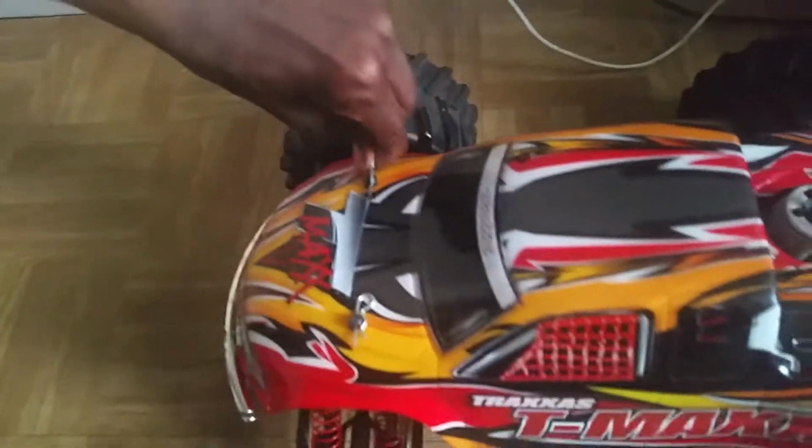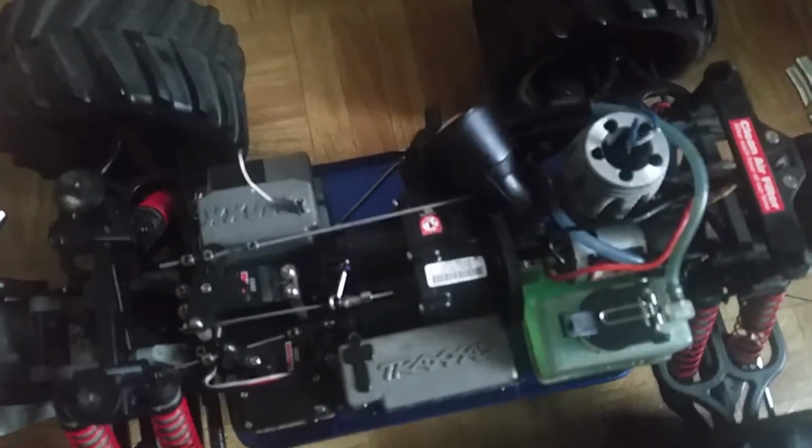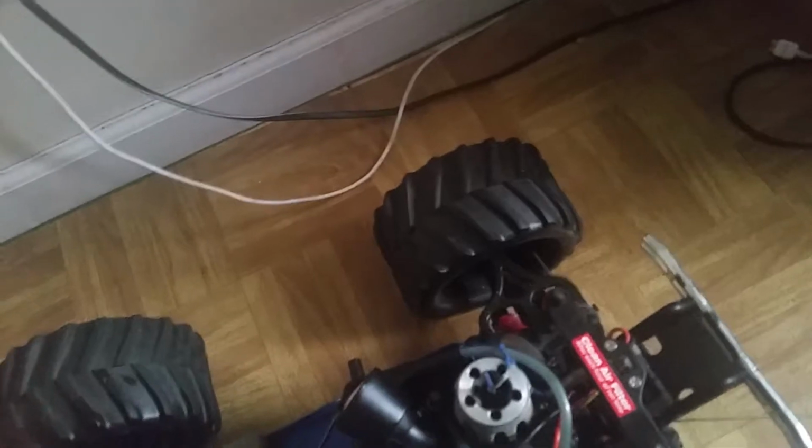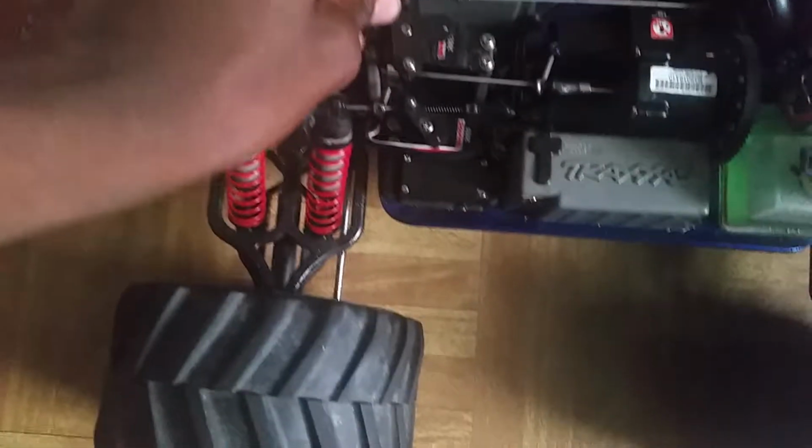Now, tuning and starting all connect, because if you don't have a good tune, you can't start your car correctly. Okay? So if your engine is rich, then it would be harder to start because you're giving it more fuel and less air, and you're obviously opening the gap in the high-speed needle more.